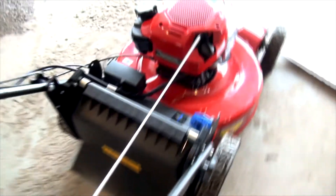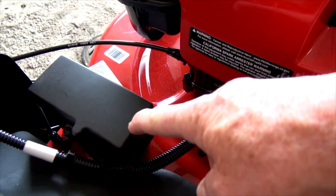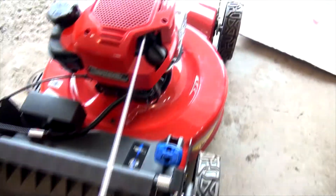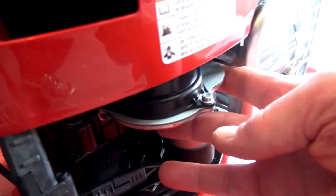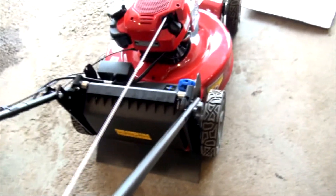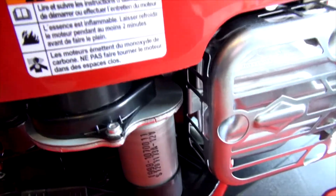It's not the pull starter either, because when it goes click, click, click — I took the fuse out and put a jumper in to replace it with a solid wire so there was no way it could blow. When I pushed the button a few times, it seemed like it locked somehow — seized or hit something. The starter would not turn. But the engine is easy to turn over by hand, so it's not the engine being stuck. It's a gear not meshing properly with the flywheel.